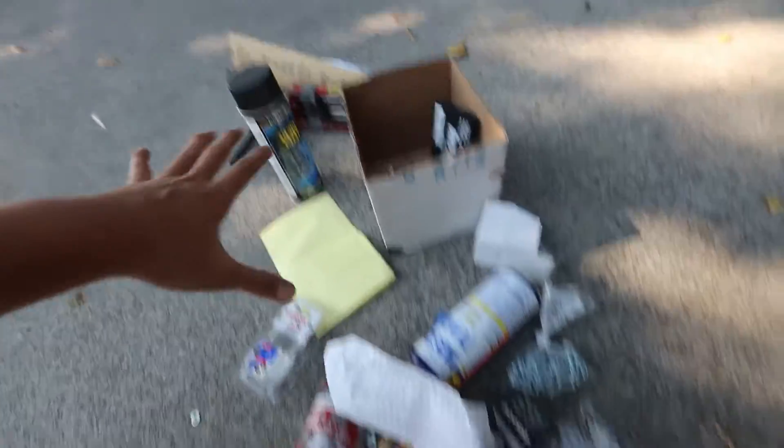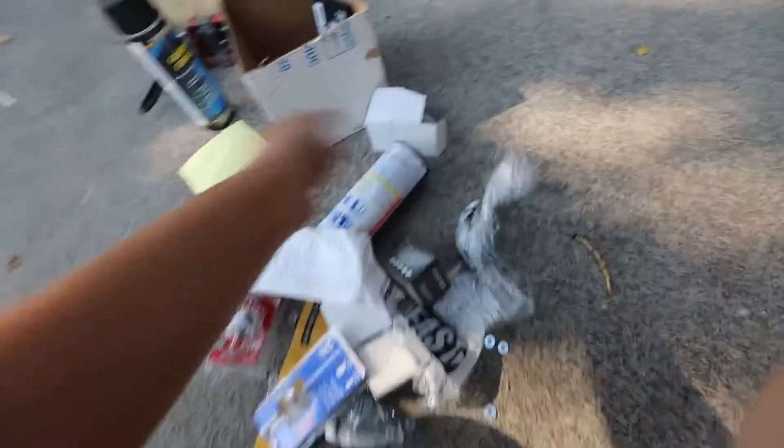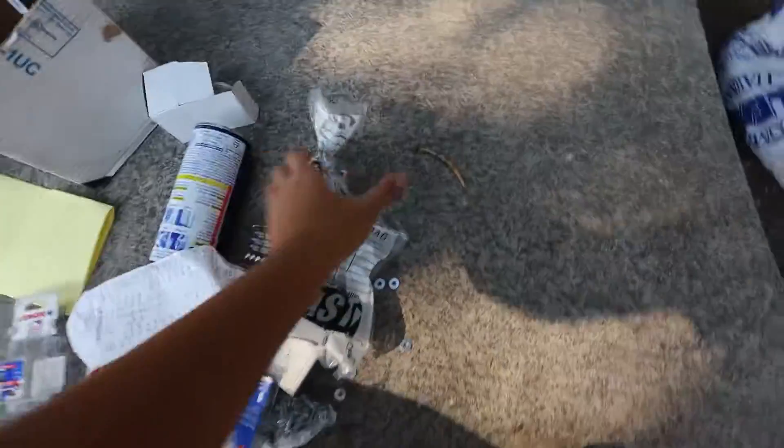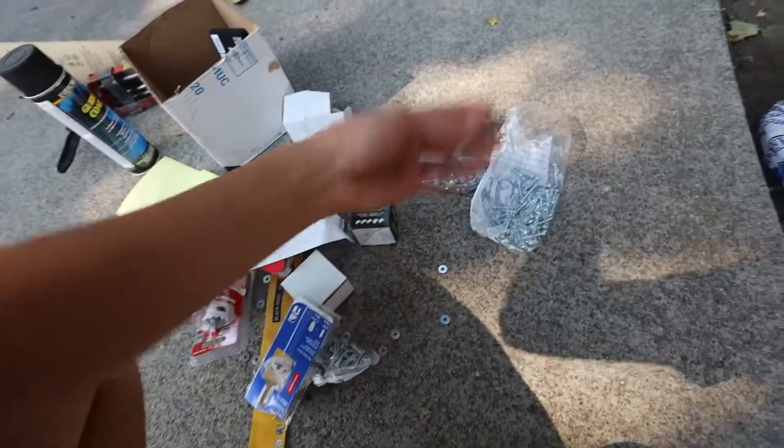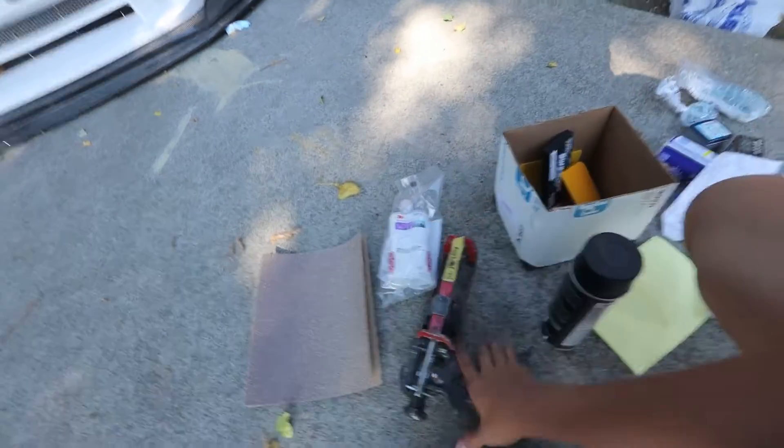All right, everything is laid out. The first thing you're going to need is some hardware — given the name hidden hardware. I bought a bunch of different bolts, a bunch of different sizes, just so I can decide what size is best. You're going to need some washers and nuts for the bolt. Next thing you're going to need in order to make the bolts hidden is panel bond. This is essentially like liquid metal — it's super strong. This is what's going to bond the bolts to the wide body kit. I'll leave a link in the description. You're also going to need a 3M applicator gun in order to use it — I rented this one from my local body shop supply store.